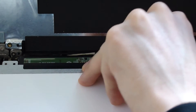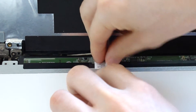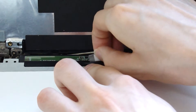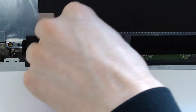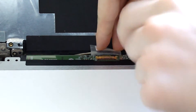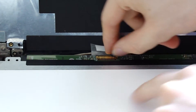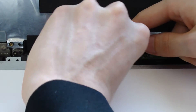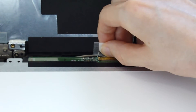It has a little plastic piece covering over the top of it, so we're gonna just lift up on the plastic piece and pull it from the end away towards it. So once that's pulled off you can leave the cord — that's perfectly fine. Now this kind has a latch. There's a little latch on this side. The connector — you want to just gently lift it up. You can use your fingernail or a plastic spudger; that's perfectly fine. This little lever pulls up — make sure you pull up on the lever before you start pulling, then pull it away from where the lever held on and it should just pop right out. Just be gentle.